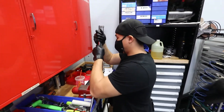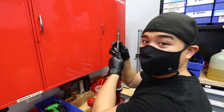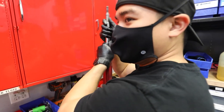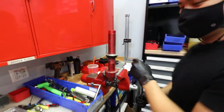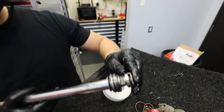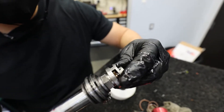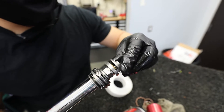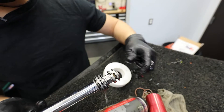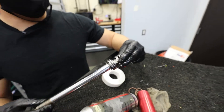Now that we got the guide out, there's going to be fluid - it's going to be everywhere. Just wait. This is messed up - this shouldn't happen. Normally, this is for the rebound adjustment. If you look really closely, there is a little ball in there. That ball should be inside a hole with the spring, and it's not. Also, this should be stuck in this groove - it should never come out, because when it's like this, you don't have any rebound adjustment.